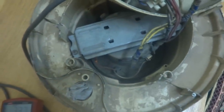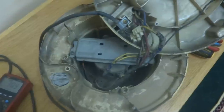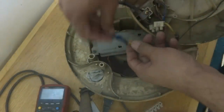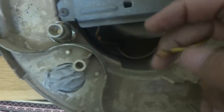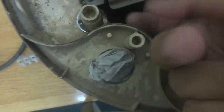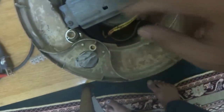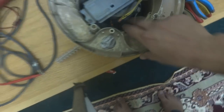By some vibration it came off. We will connect this to this and then test if the unit is working. What I'm doubting is this cable - I'm removing this tape so you can see this cable has a rounded shape, which is telling that this cable had been twisted on. There is stress in the two covers - that stress had put stress on the cable and it came off due to vibration. This machine while running is producing vibration, so that's why this came off.